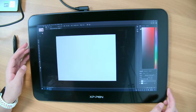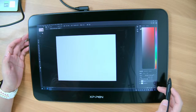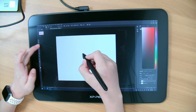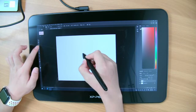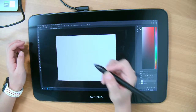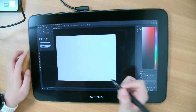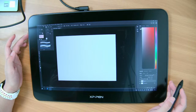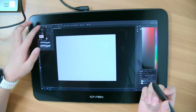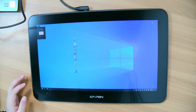The first one, you can enable touch panel and stylus simultaneously so your hand and stylus can work at the same time. The second one, we can prioritize your stylus. If both your hand and stylus are touching the display, it recognizes your stylus first and disables the touch function to avoid errors from your hands touching the display accidentally. And if you remove the stylus, you'll be able to touch again. The third mode, you can turn off the touch function and use the stylus only. So you can choose your mode according to your preference. For now, we'll use the second mode in the following demonstration.